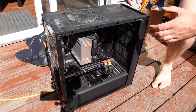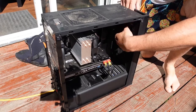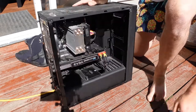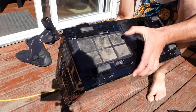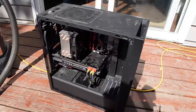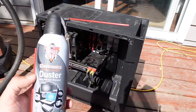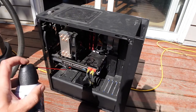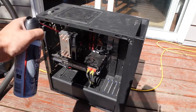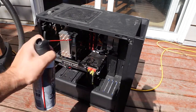The first thing you're going to want to do is remove your pre-filters. I have two on the front. They usually just pop out because they're magnetic. You can see the dust coming out. And as you can see on the bottom of my PC, I have another filter and it just slides right out like so. Next, if you're lucky enough to have a shop vac that has the blowing feature, you can just blow the air in there and get all that dust out. If you do not have a shop vac with the blow feature, get yourself some duster. You just simply spray it in there and it'll get the majority of the dust out. Make sure you get in the heat sinks of your CPU fan. It works actually surprisingly really well, but I'm going to do the shop vac here.